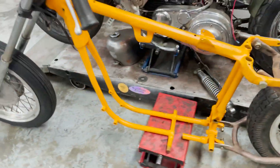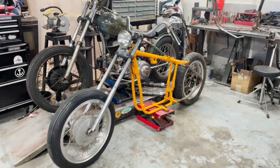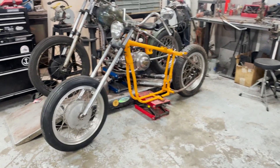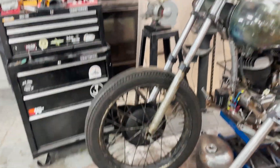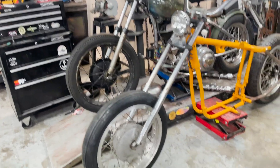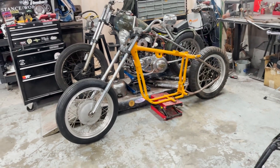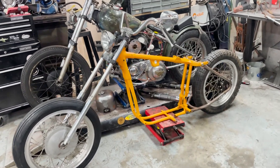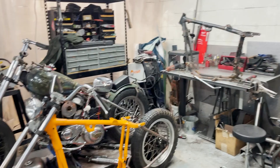The bike has just been sitting here for quite some time and we can't move it around. So I'm going to go ahead and take the K-model front wheel off the flathead, throw the hamburger drum front wheel onto the flathead for now, and put this together with the K-model wheel, the shorter front end, and early style lowers. We'll see how it goes — come along as I do this.